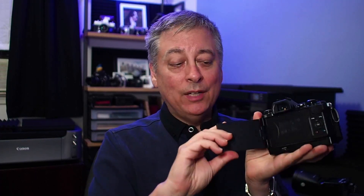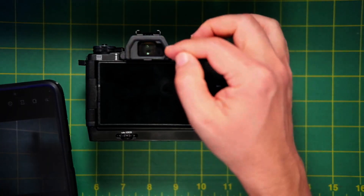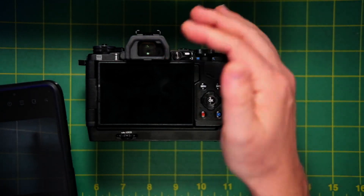When you take your eye off, it activates again. The eye sensor on my M10 Mark II has gone bad, so I'm having the same problem. When it's fully placed back onto the back of the camera, it doesn't turn on — it's off. It only works when I pull it away from the camera, or in this case on the M5, you articulate it and it comes on. Most likely what's wrong is the eye sensor in the EVF has gone bad.